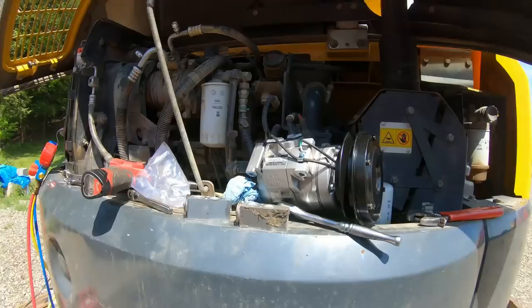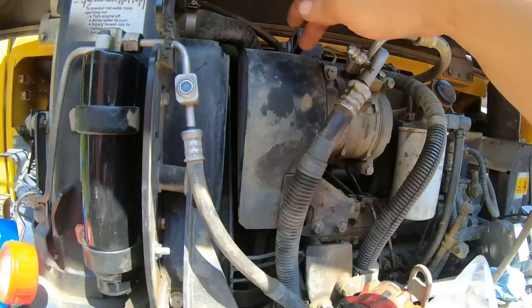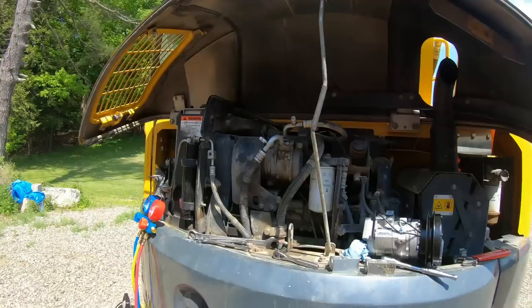What we're going to do is tear this down. I'll keep the old compressor because it's probably good, but I'm going to put the brand new Denso in — it comes pre-oiled, make sure you get one that is pre-oiled or you'll have to add oil. We're going to evacuate it and pump it down for about an hour until those gauges look right, then do a leak test for another 45 minutes. If nothing leaks, we'll add the refrigerant and see if the problems are fixed — it's about 90 degrees today on Memorial Day.